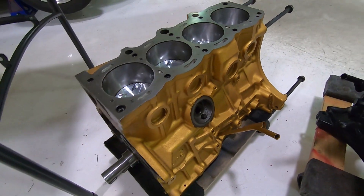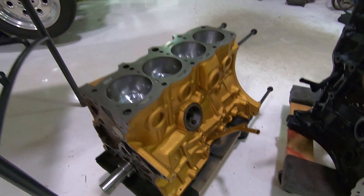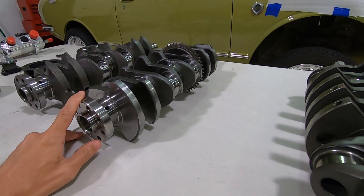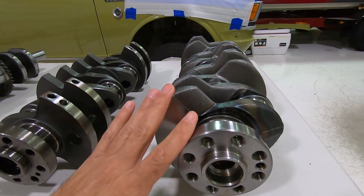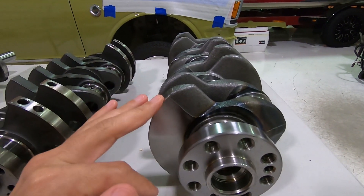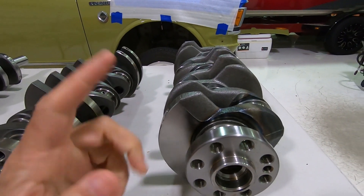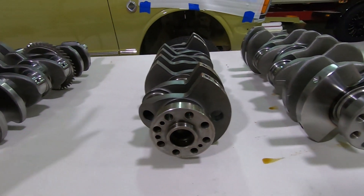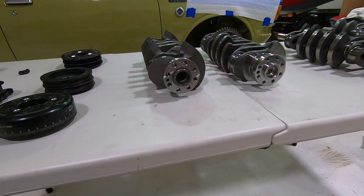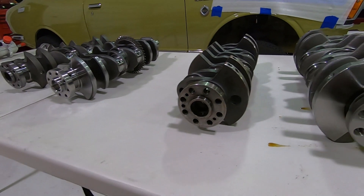These will be shipped out and built elsewhere, but we'll post updates. I hope this gives you guys some insight on the crankshafts. Don't get confused thinking you need a stroker to make good power — a standard 3S crank makes plenty of power, is very reliable, easy to get parts for, and bolts right into a 5S block with no problem. Deck heights are the same, everything is exactly the same, so don't think you'll lose out if you don't run the stroker setup. Like and subscribe — I appreciate all the new subscribers and I'm going to keep going with the videos, so stay tuned.